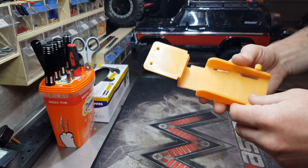This is the side hill test again with the new lower tray in, same 3000 milliamp hour pack. The last tray was about 35 degrees maximum, so we'll start at 36 degrees. Let's go straight to 37. Well guys, I'm shocked — 38 degrees! I didn't think for a minute it would manage that. So we'll say one degree more than the stock tray.